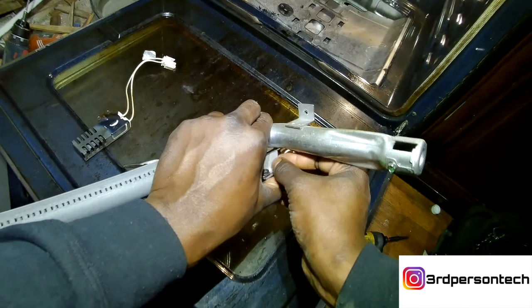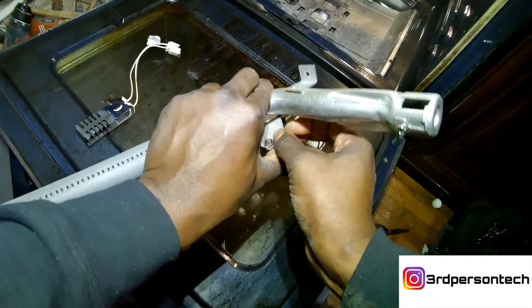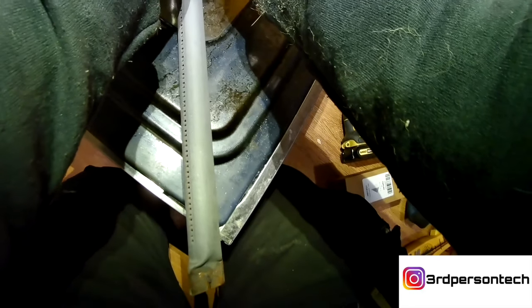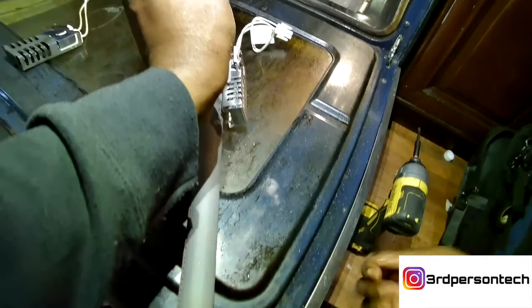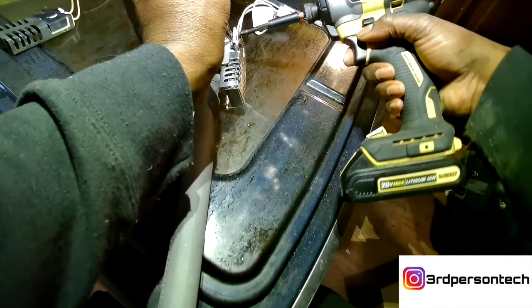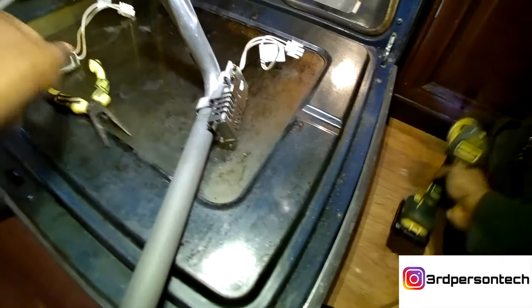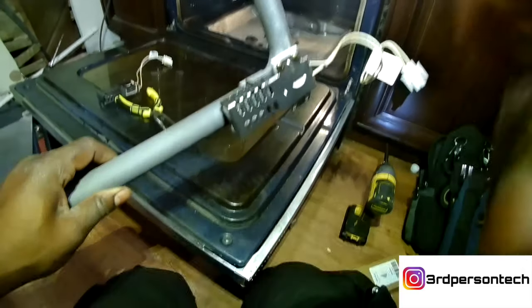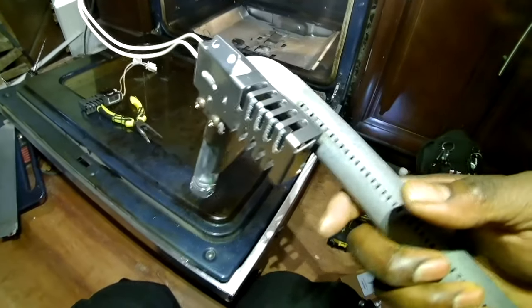Now I'm gonna put on the new igniter. It's going to be a little difficult to use your finger, so you might have to get a pair of pliers to hold those nuts in place while you use your screwdriver or drill to tighten them up — just like this. I've got needle-nose pliers holding it. That's not the exact ideal tool, but it's possible to use and get away with if you know what you're doing. Now we've got the igniter mounted to the burner tube, and we're gonna put the burner tube back inside the oven.